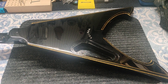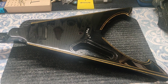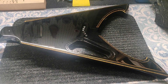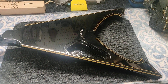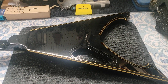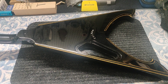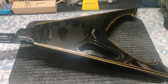Sometimes with clear coat you have to let it set for a couple of weeks before you can go back in and fix the issues. If you go in too soon, especially with colors like black, they can show up again. So we had a solvent pop issue that was attacking different parts of the actual finish. And solvent pop kind of sucks.